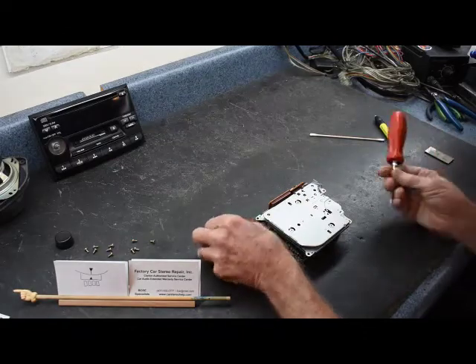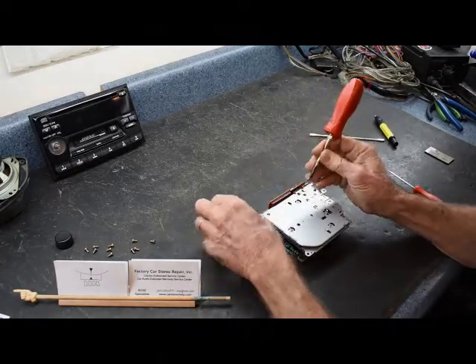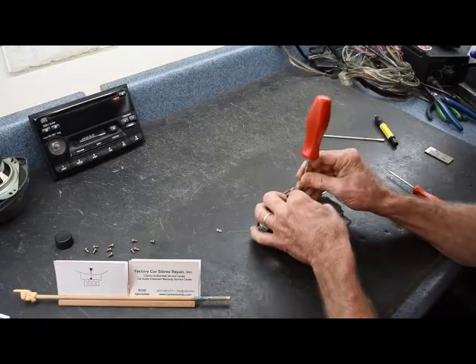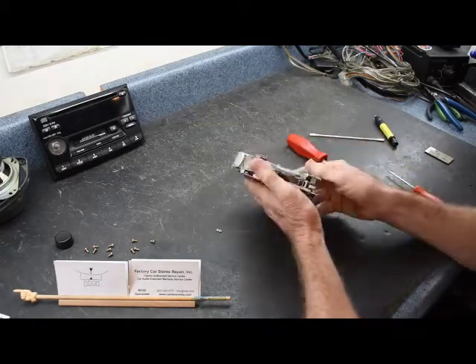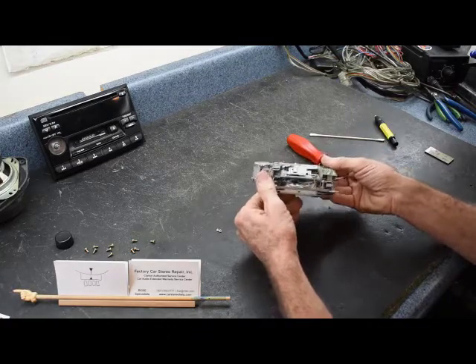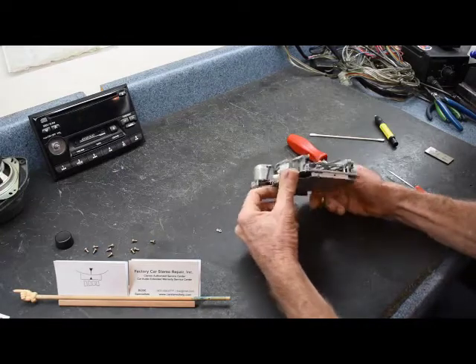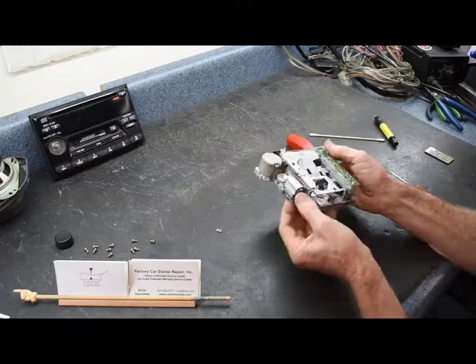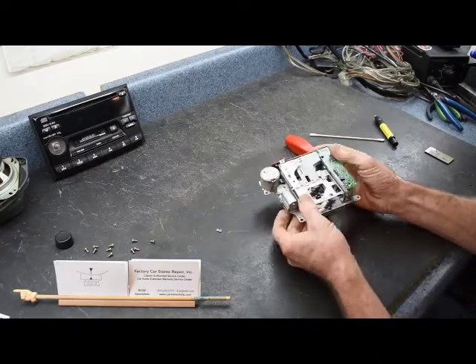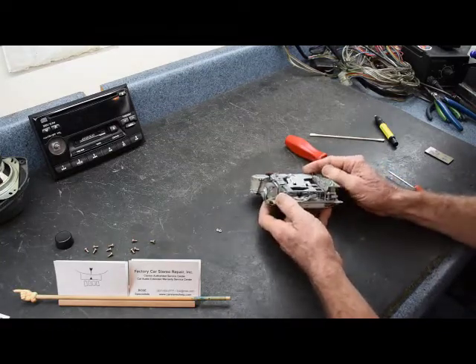This should all come right down and fit into place. This procedure probably takes care of most cassette problems — about 90 to 95 percent of the time. The remaining cases are split between hitting the gear and throwing the alignment off while putting it together, which may just take a second chance at alignment, and very rarely a bad switch — which is available if needed. I hope this video has been helpful. If it doesn't cover the problems you're having with your radio, our contact information is at the end. Please subscribe — thank you for watching.